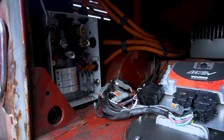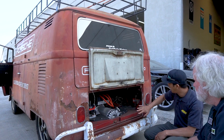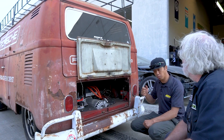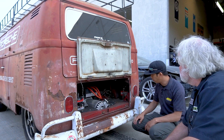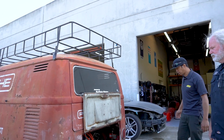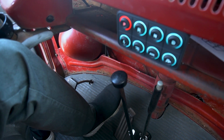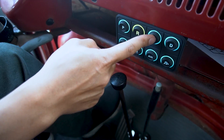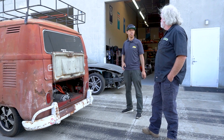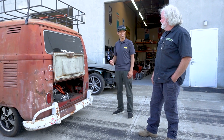The charging is controlled by the VCU. There's a little connector here that's wired to one of the onboard chargers currently. The goal is to have a switch inside the charging cover — a switch there for your 220 or your 110 charging. So if you have big charging and you want to use two chargers, flip that switch up, fairly fast charge in there. And if you're dealing with just a regular 110 outlet, flip it down, one charger, keep the supply circuit happy. We added a brake pressure sensor that's teed into the master cylinder that we're using as a brake switch. Above a certain pressure threshold, the VCU is using it as a brake switch. And we're using that pressure range as the regen input — so the more brake pedal you apply, the more regen you get. We got so much regen that the back end hopped at one point, so we had to turn it down a little bit.